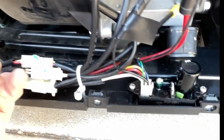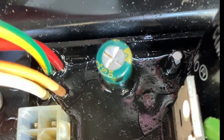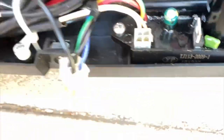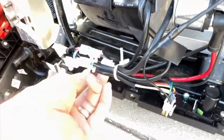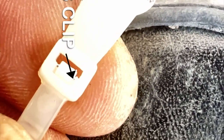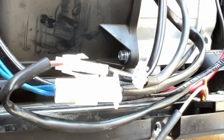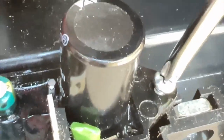The cover will be attached to the pull handle so you won't be able to get it completely off. Then we'll identify the part we're taking off and follow all the wires coming to it and out of it — disconnect that one, follow these wires to where they go, and there'll be a couple more connections to disconnect. These little brackets hold the wires so they don't move around inside; just unscrew them. To get the little snaps off so you can reuse them, take something like a knife or a flathead screwdriver, push that down, and those things pop right off.